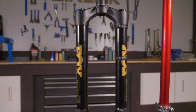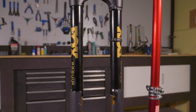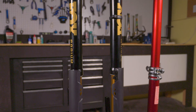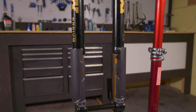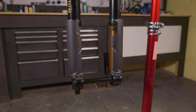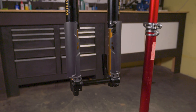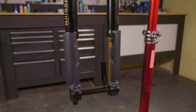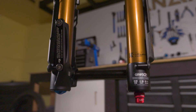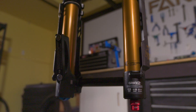When we started this project, we were looking at ways to reduce friction in the chassis. And if we could reduce friction in the chassis, we could add damping to the damper. We wanted to do that to gain better control and better grip and offer better comfort for the user. As we were exploring friction in the chassis, the team suggested, should we look at an inverted architecture? Because this type of architecture has some benefits for friction.